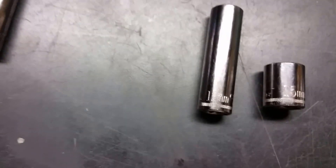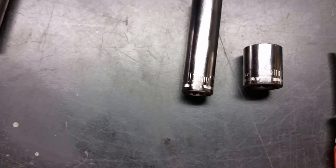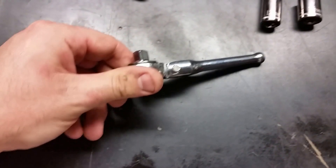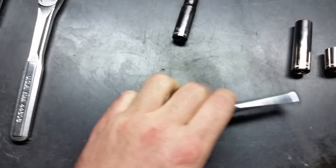On the bottom you're going to need 12-millimeter and 15-millimeter. The 12-millimeter is to remove the cable on the bottom. The 15-millimeter is for the bolt on the bottom for the starter. You're also going to need a small screwdriver to remove another wire on the clip. You may also need one of these little stubby adjustable ratchet wrenches to get into the spot — it's a little tight.